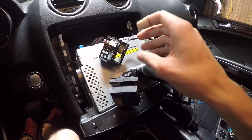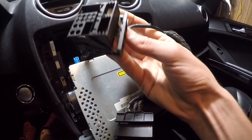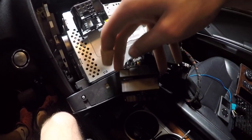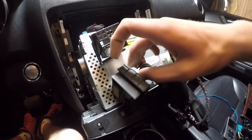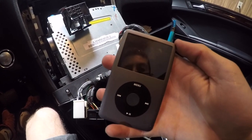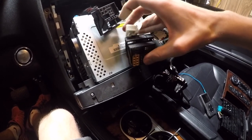The solution I found — and this actually works really well — is this cord that comes from your car and plugs into the radio. Take this white cable here; yours may have more, but pop this one out. This houses your auxiliary cord — the cord you can plug into in your glove box. Then come over here on your adapter piece, the piece that will now plug into your radio, and pop out this white cord. This has the audio input for the auxiliary cord and the iPod. The radio is smart, so if you have your iPod plugged in it won't play audio from the auxiliary cord. But the iPod never actually turns off that output — I tried this by plugging headphones in when it was playing through the Mercedes and it still outputs audio. So just leave that unplugged, and go ahead and plug in that cord from your auxiliary into the main harness that will actually plug into your radio.